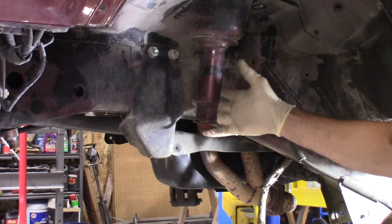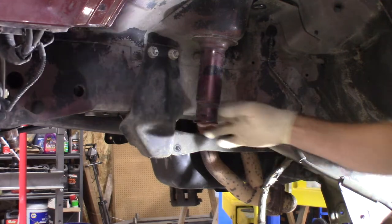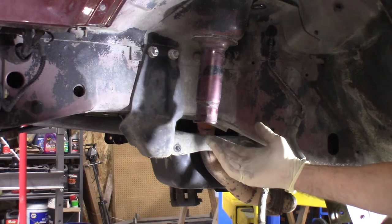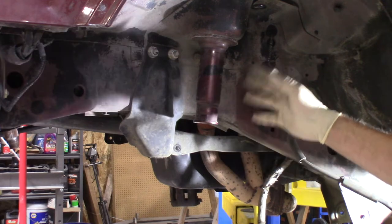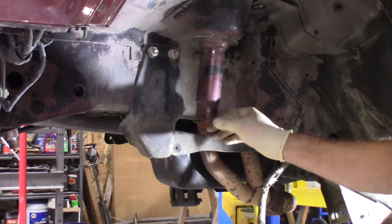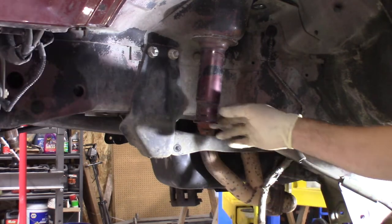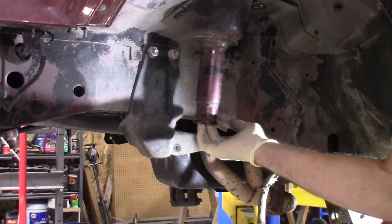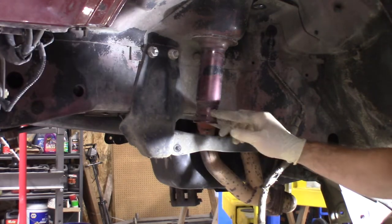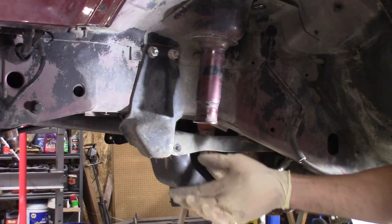What you're going to have to do is actually cut this bottom end here for your bump stop mount. Now on some of the older rigs and TJs, this part actually screws on so you can unscrew it — it might be stuck, so you may need a pair of channel locks to grip and turn it. Good thing is there's a hole already threaded there for the new setup, so no tapping or drilling needed. For someone like me though, this is an '01 and this part is welded, so we're actually going to have to cut it off and tap for the replacement bolt. You don't want to cut too much off — there is a flat washer inside with a hole in the middle. Measure from that flat washer out to the outside edge, mark it, and cut it off there. You can use a die grinder, a cutoff saw, whatever your weapon of choice.